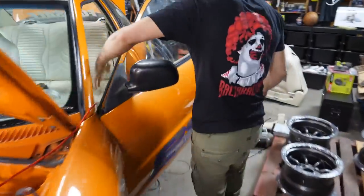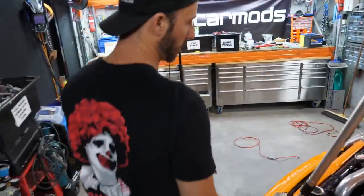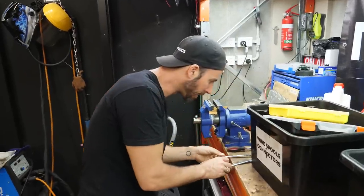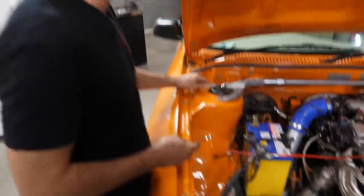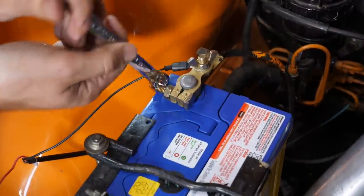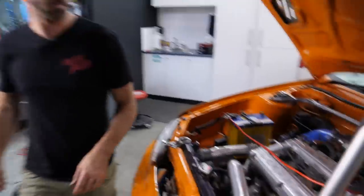That wire's now live, so be careful what you do with it. Yeah, so I'm actually going to unplug the negative terminal of the battery like we're meant to. Yeah, it's not a bad idea, because I know we didn't, but now we will. And once that's done, then we connect that end up to the amp. Is that 11 or 13? 13 mil, why? Because Bunnings, that's why. Oh no, because that's like Imperial, probably. So take that off because otherwise our positive is live. So we might connect that up first. Okay. And then put it all back together. Cool. She's off? Yep, that's done.